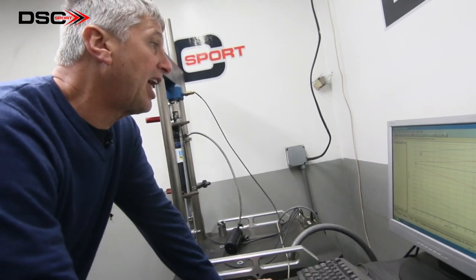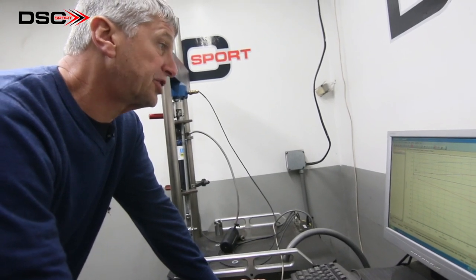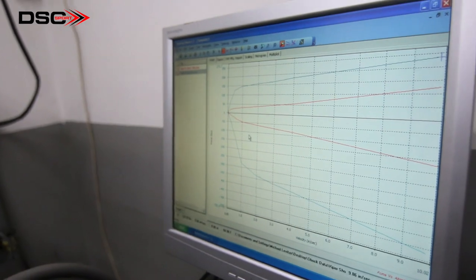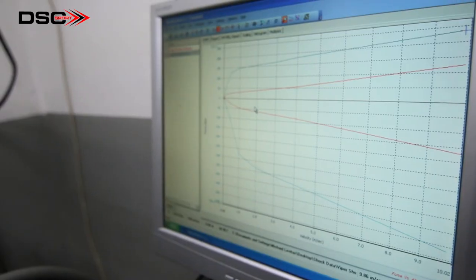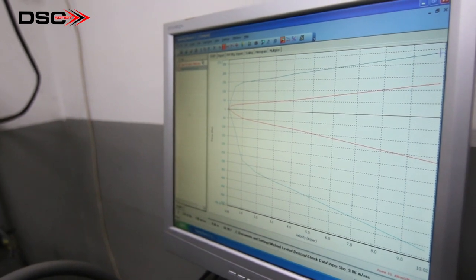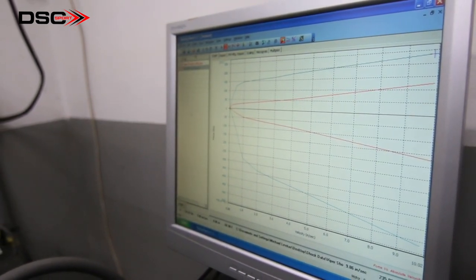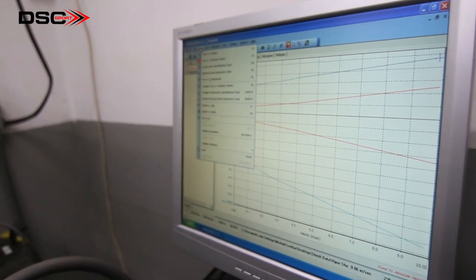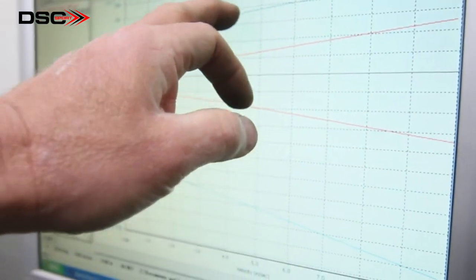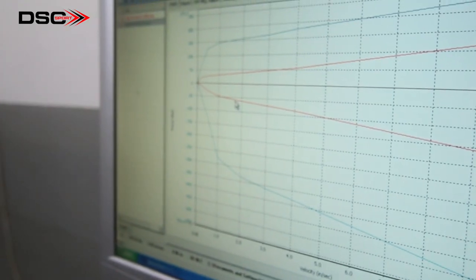You'll see that this is at a lot of low speed. That's the reason the Viper rides so harsh when you're in sport mode — due to this low speed. Anything under two inches per second is a lot of low speed. You can see the amount of rebound it's got, which really tries to lift the tire. It's fine for a road course when combined with the softer setting to get some grip into the tire — you can kind of combine this, and that's what we found with the Ford Focus.